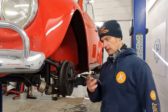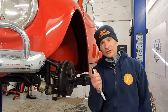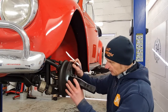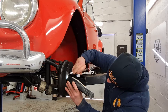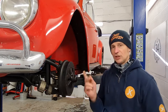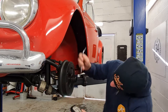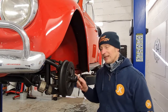I'm going to use my torch and the correct tool. This is the correct brake adjusting tool because it's actually softer than a screwdriver — a hardened tip of a screwdriver will do severe damage to the soft adjusters. I'm using the correct tool and a torch so I can see what I'm doing. I'm going to find the adjuster which is here at the front and wind it off. I'm winding the adjuster up the thread which draws the adjuster back on the top half, and on the bottom we're doing the same — winding it towards the bottom which brings the shoes in. That's de-adjusted; we're not touching the drum anymore.